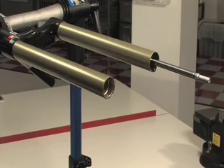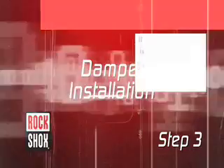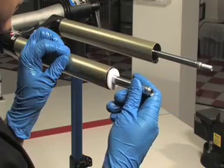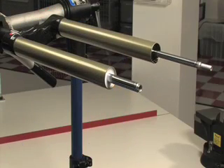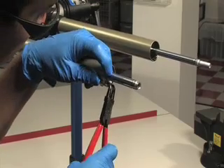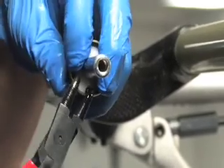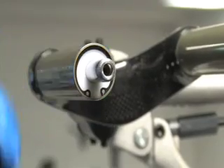Spray isopropyl alcohol into the upper tube. Wrap a clean rag around a dowel and clean the inside of the upper tube. Insert the rebound damper piston into the bottom of the upper tube at an angle with the open-ended side of the glide ring facing outward. Continue to angle and rotate until the glide ring is in the upper tube. Position the upper tube base ring seal and seal head into the upper tube and press into the upper tube with your thumb. Use internal snap ring pliers to secure the seal head into the upper tube with the retaining ring. Make sure the retaining ring is securely fastened in the upper tube groove.